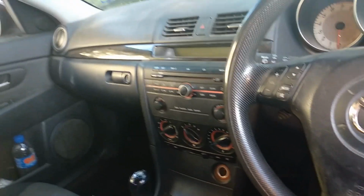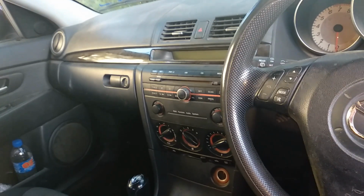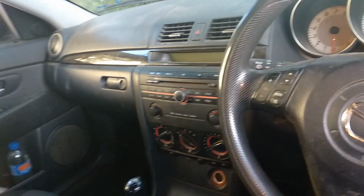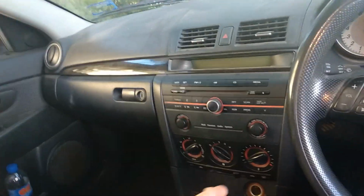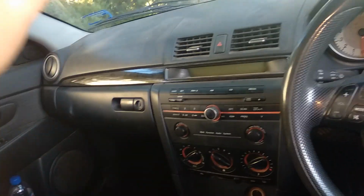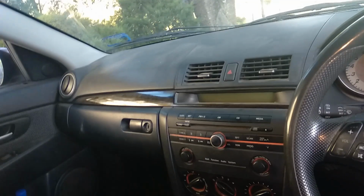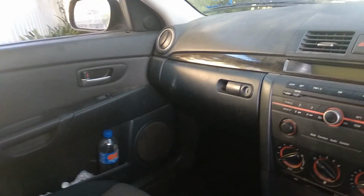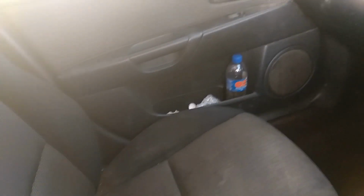Eventually I'd like to upgrade the system to 10,000 watts. I think that'll be the goal of this system, to get it to 10,000 watts within 5 years. I'm currently thinking of doing 3 15s in a 6th, having a big slot port down the bottom, series aligned by the way, and then having another slot port in the enclosure and having the subs magneted up. So a big chamber up the top, and then it kind of comes down. That'd be a 2-to-1 instead of the 3-to-1 right now. So it'd be 180 litres in the rear and 90 litres in the front, and a big slot down the bottom, and then the sound comes all the way up. It's like a big scroll, kind of like a tapped horn too.